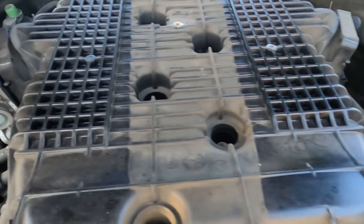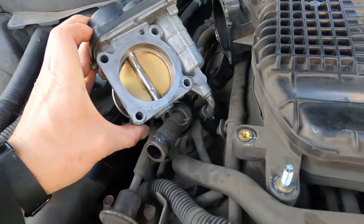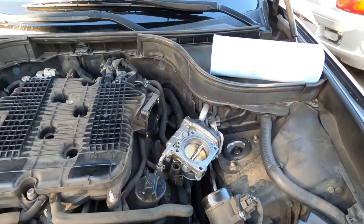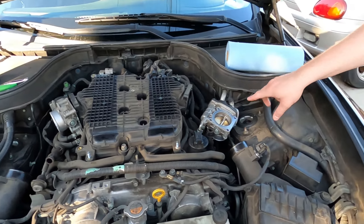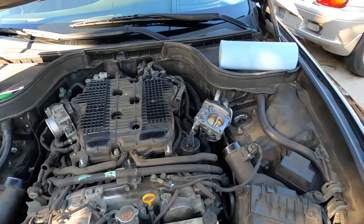Driver's side clean, passenger side nice and clean. There's still a little residue, but that's really not a big deal — it's really the sides and right where the throttle plate meets that matters, because that's where gunkiness will eventually start to stick the throttles.